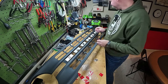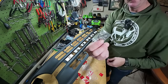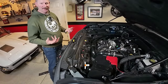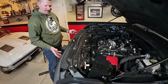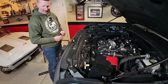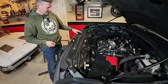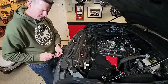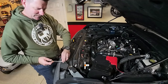Let's go ahead and flip the grill over and put on the little clips to hold them on more permanently. I just tried to pull the winch off and the bolts holding it on are really, really tight. If I remember correctly, I cannot pull this grill off with the winch on, but I'm going to try it one more time without removing the winch just to see if it works. The first thing we need to do is pop off this cowling — you take something that's not a screwdriver, something more panel-friendly, put it under there, and just pop these off.